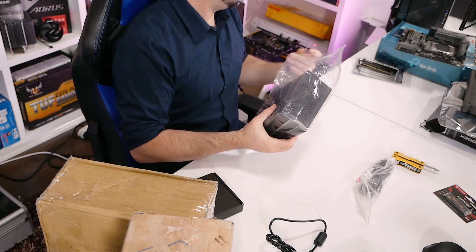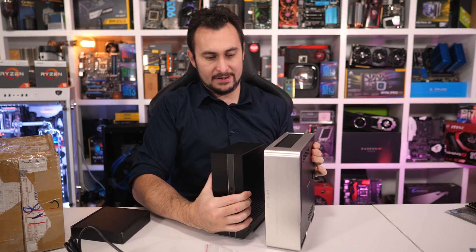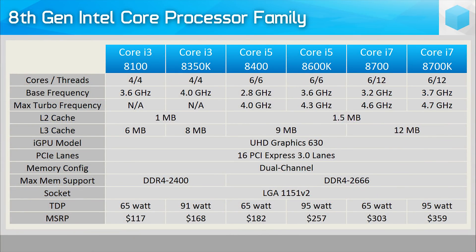Just as I began testing, a long-time subscriber notified me that in my previous video I had spread some misinformation about Intel's turbo core ratios. As most of you are aware, Intel made the marketing decision with Coffee Lake CPUs to only advertise the base and single-core turbo clock speeds, and this is what caused the conspiracy that these CPUs couldn't hold the all-core turbo frequencies reviewers were seeing. It turns out the claims aren't entirely true — the 2, 3, 4, 5 and 6-core turbo frequencies are still publicly available and can be read from the CPU's default turbo boost multiplier table, though Intel isn't advertising them so you have to do a little digging.